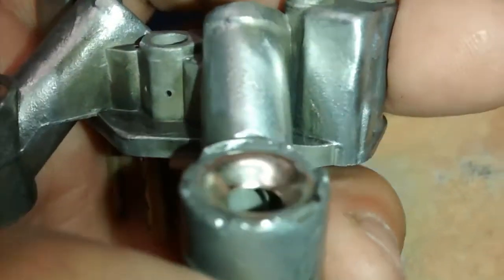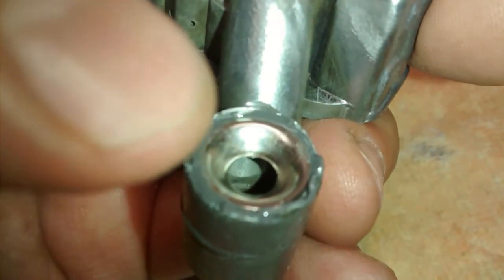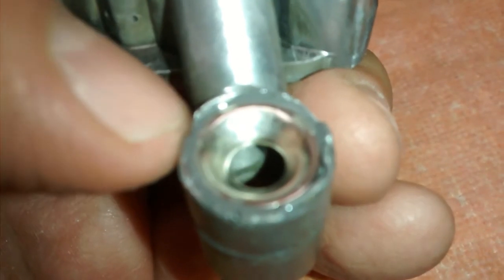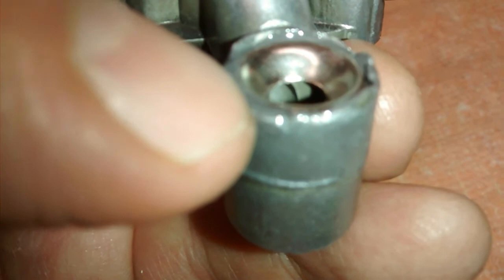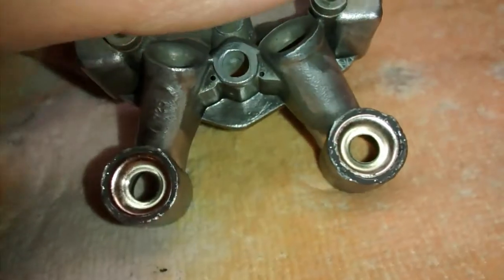So instead of trying to mold this and taper it down to hold a press fit on that booster, I just put a little bit of JB weld on the internal edge of this Venturi cluster circle, and then just drop those Venturi boosters in there, and that should do it.